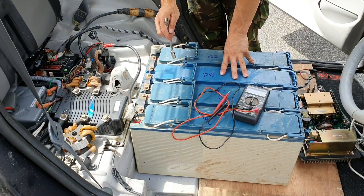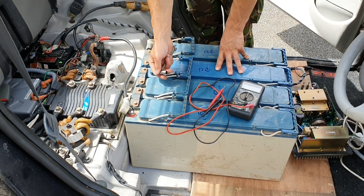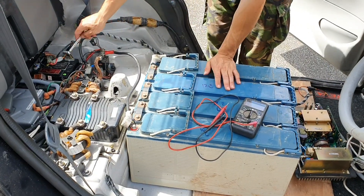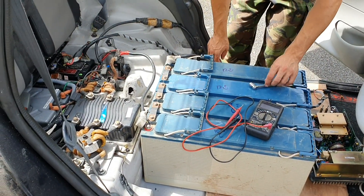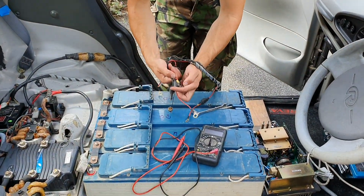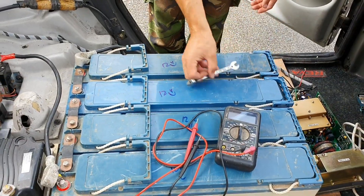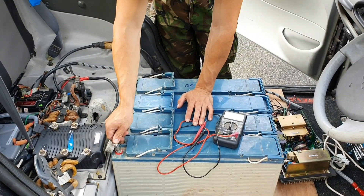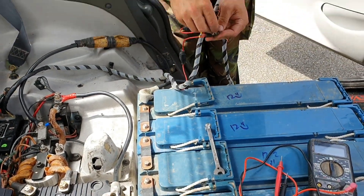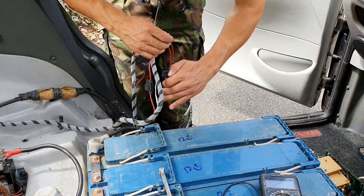What we've actually discovered is that the charger will work if you unplug the EMS, but you're putting 48 volts directly into these packs. With lithium that's no problem, but with lead acid it's at 40 amps into a 166 amp-hour battery, so I'm not sure how that works. What I've actually done is plugged all the EMS back in. In order to get the charger to work, we just have to connect all of these together and screw it into the positive - literally all of them. And it seemed to work. We'll wire it up and then show you again.